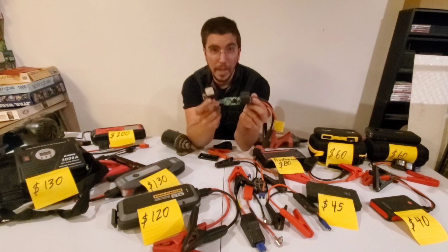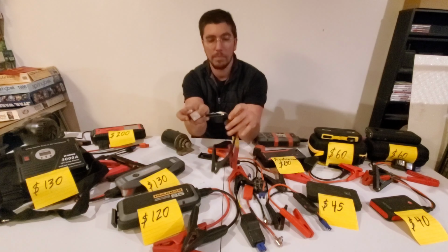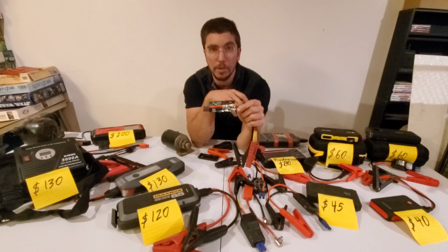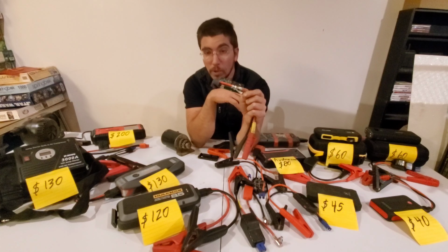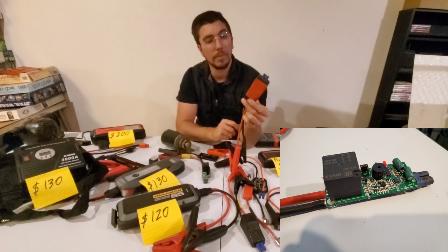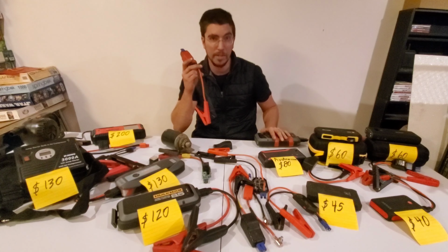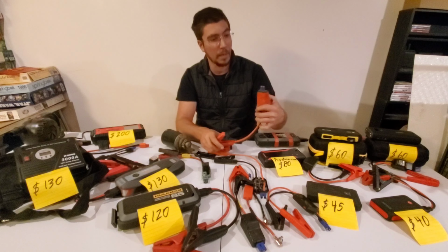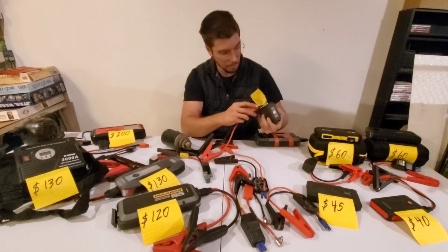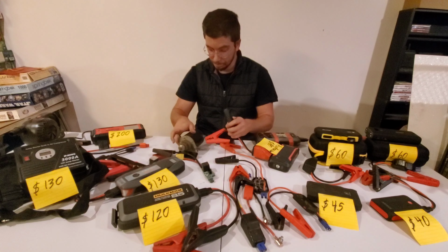This is what they route every single bit of all that cranking amp through, and they will eventually, like this one, fry. And you will end up with a nice little bursty bit of sparks, and it will never work again. Thus, we have this one, which is currently wrapped up in all kinds of red tape. You'll notice there's another red tape one here. This is what happens if you just totally, utterly bypass that so that you don't have to deal with it anymore.